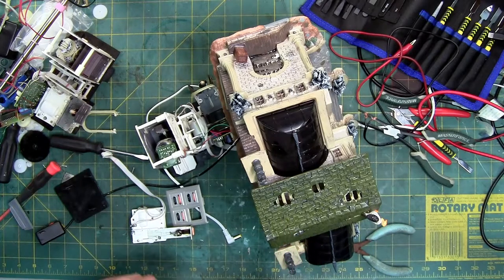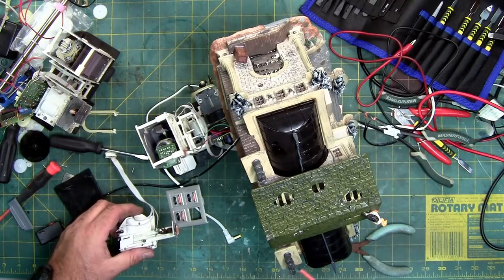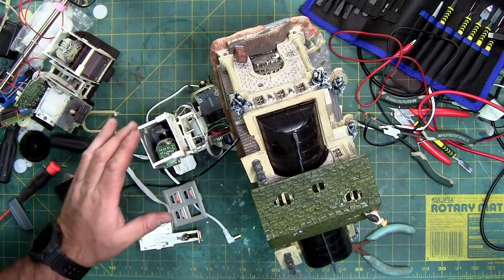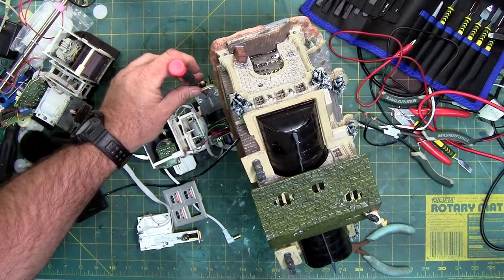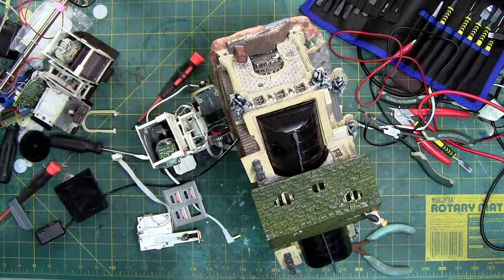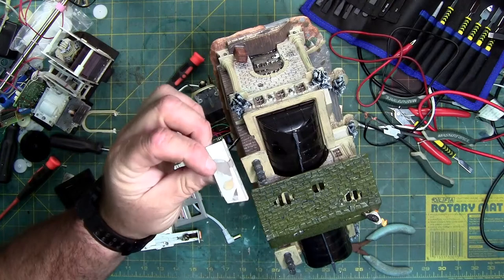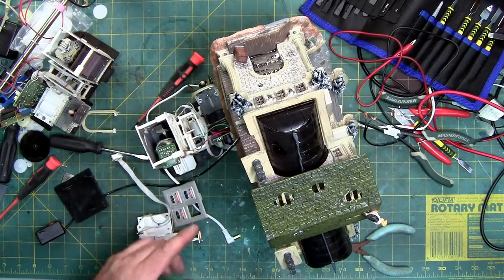Pop off the skylight — be careful, there are wires attached to it. When you reach inside with a long, thin screwdriver, there are fairy light wires in here which are thin — I mean thin — coated wires. Try not to rub the coating off, and do not break them. They are a pain to re-solder. Unscrew this, but you need to get the figure out first in most cases. If he's stuck in the out position, take your screwdriver, stick it behind the door behind his head in front of the door frame, take out that one screw, and push him in carefully while putting pressure on the door so they close. Then this whole thing will come out the bottom once you break the glue. Like every Lemax, the whole base is glued in — yes, you do have to remove the rubber mat. If he won't go in all the way or gets caught, pop off the plastic plate — it's just held on with glue. Pull this piece out carefully; there are wires that go up inside that do not unplug. Work with this — it's not going to be the easiest. It's going to frustrate you, so patience is very important.